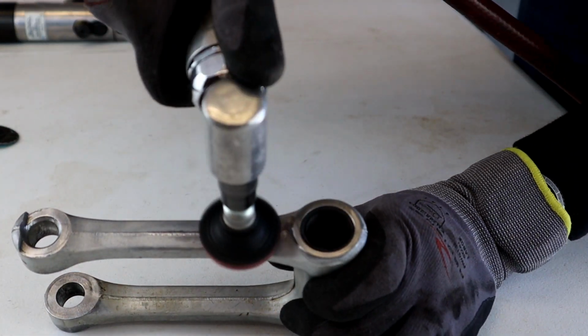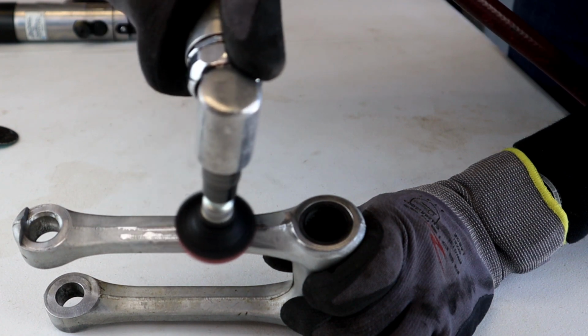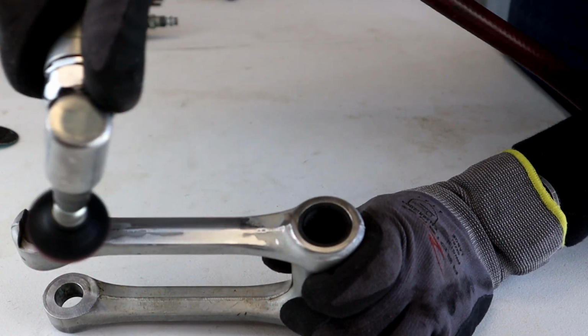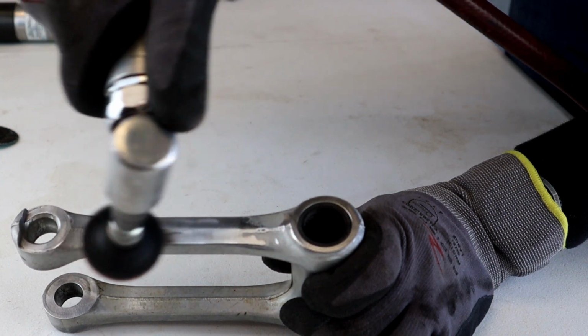So I'm starting with the high RPM die grinder and the most abrasive wheel because I want to start cutting a good deal of material off to start. It's going to leave sort of a coarse finish, so I'm going to need to step down to the less abrasive or medium wheel, followed by the most gentle wheel before I bead blast the part.